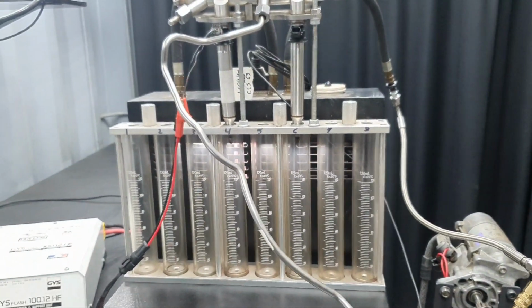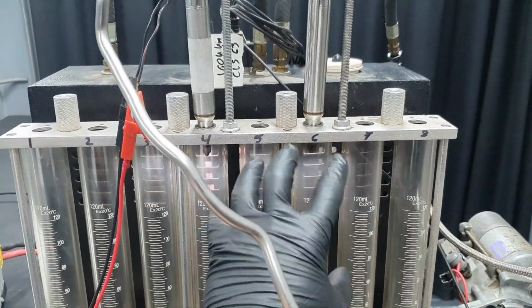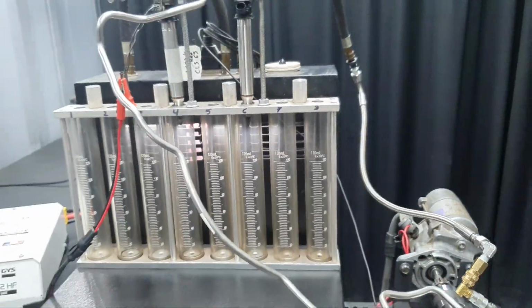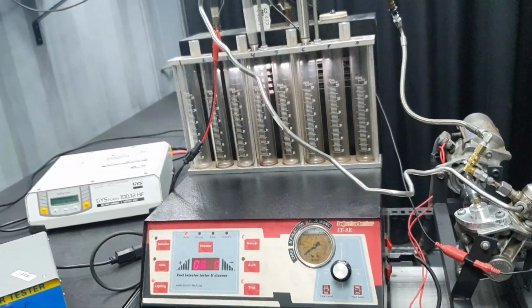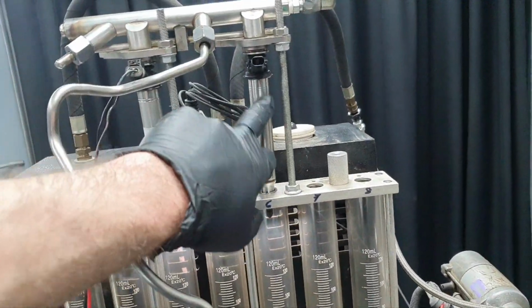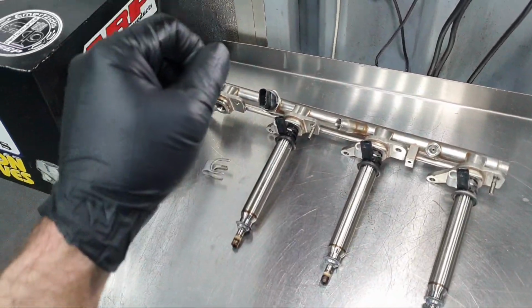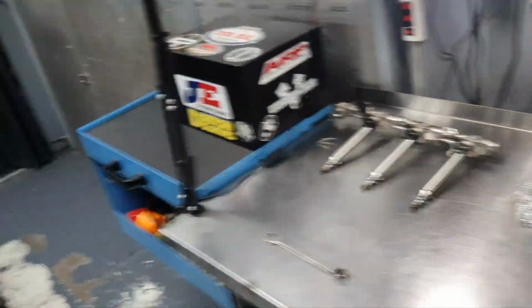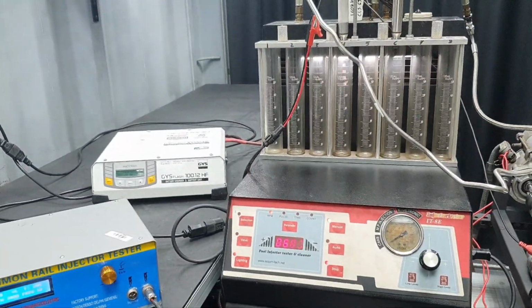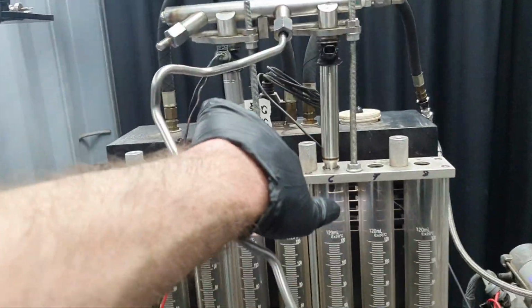Also, this is one variable that would be ideal if I could demonstrate the temperatures inside the cylinder head, but I cannot do that obviously. I'm happy that I can run this test at least. In any case, I was willing to change the number one fuel injector. I was not willing to keep the number one fuel injector since the piston melted. Alright? I'm going to check all of them, like I said, also checking the high pressure pumps, then moving on. That's it for now. Let me spend how many hours now checking, writing down, disassembling this injector.